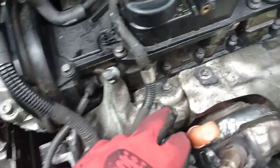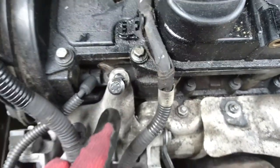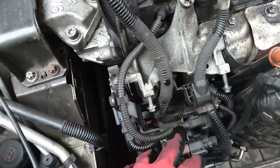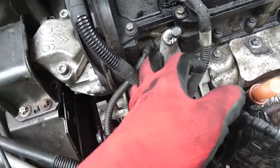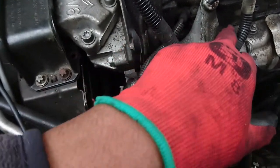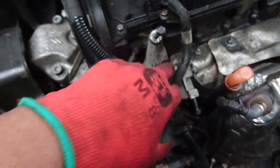There's this bracket here - to remove this part of the camshaft you have to remove these, but there's just one bolt underneath this bracket. Now this is a nightmare for mechanics, they hate this part. My plan is, because I'm going to remove the alternator anyway, I'm going to remove this bracket. If I wasn't going to remove the alternator I would just cut here, make a hole, put the cable tie and clamp it on this and leave it.